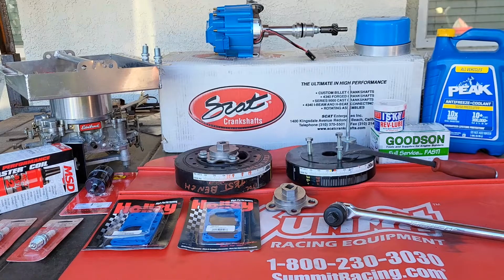I rotated the push rod in my fingers and I cranked down on the nuts. I didn't crank, that's the wrong word. You go very slowly, and just till it stops, you stop. Then you go to the next one, then you turn the distributor, using this, to the next mark you made on the base, and then all 8 times. And then you haven't gone too far. If it's a solid lift, it's gonna expand. Not very much, not enough to do damage.